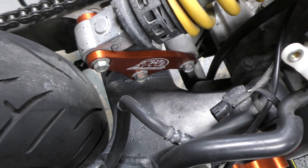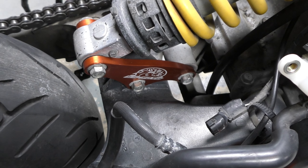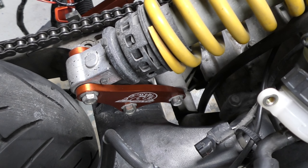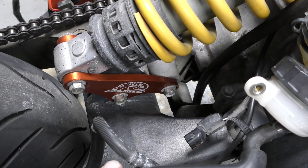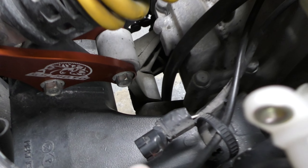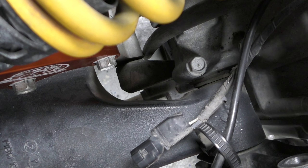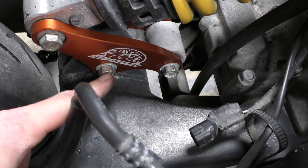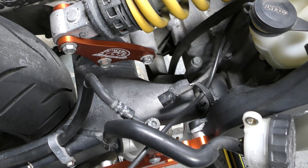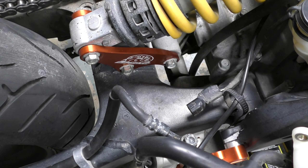Some quick notes on the new Saggy Ass Fix shock link plate install: even though you jacked up the bike to get the old plates off, with the new plates the bike is going to be raised a little higher, so you have to jack it up a little bit more — maybe a couple more pumps. Start with the front bolt first because you can push the dog bone forward to slide the bolt through. It's a little tight, so push it forward, slide the bolt through, then bring it back, and you can line up the other two really easily. You want the bolts to slide through easily by hand, just like when you took them out. Make adjustments to your jack where necessary.